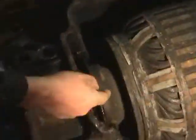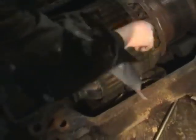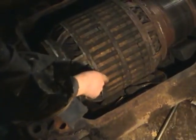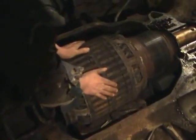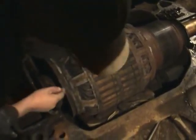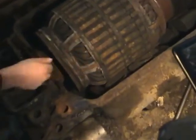What's happening is that as the bearing wears away, the armature gets closer and closer to what's called a pole piece. This is the field coil, which has many many turns of wire — that's basically the magnet that interacts with other wires inside of here that makes it turn. You can see there's absolutely zero clearance there.